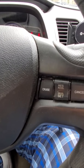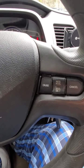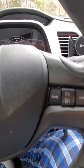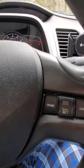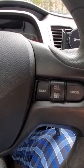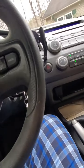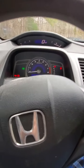If I pushed it down and held it down, the light would come on, but as soon as I let go of my finger the light would go off. I tried doing it with both hands — I would hold it down, and then at speed I would use my other hand to press set and it would work, so I knew that it was the switch.